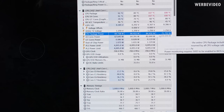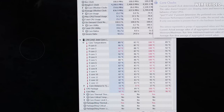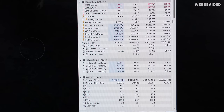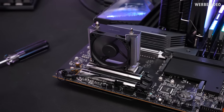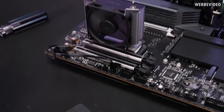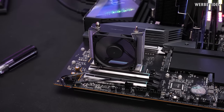This SSD cooler is able to constantly dissipate 70W. We're seeing 100°C, fair enough, and it's downclocking to an average of around 4.2GHz, but still — it's an M.2 cooler averaging 70W dissipated. Installing the M.2 drive was smooth. For an M.2 drive it will cool quite well, but size-wise it's not ideal — it already blocks a PCIe slot, and putting it further back would block the GPU.